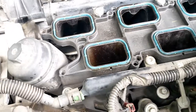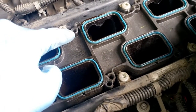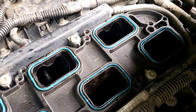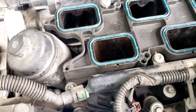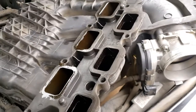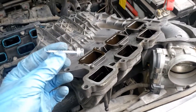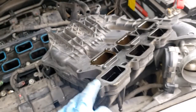What you've got to do is drill out these holes with a 7/32 drill bit. Just drill them out maybe an eighth of an inch deeper than they are now - really what you want to do is get out the old threads and the old gunk. Make sure you plug all these ports when you're doing that. Then take a quarter inch drill bit and drill out the holes in the plenum - just wiggle it around just a hair. It's going to let these bolts go in and out a whole lot easier. You don't want this to be threaded in any way.